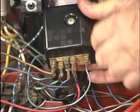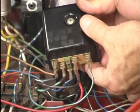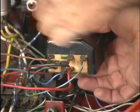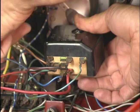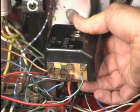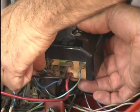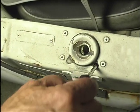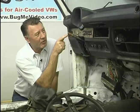All the numbers and letters for these wires are on the side of the case. Starting at the top, the brown wire is marked minus S. The black and white wire is our left turn signal, marked VL. The green and black one is our right turn signal, marked VR. Down below that is the end of the cable that opens the trunk, attached to the lever inside the glove box — that screw has to come out so the cable is free to move when you pull the dashboard back. We already have our speedometer cable undone.